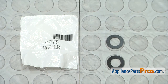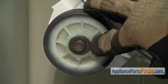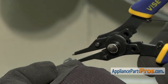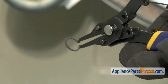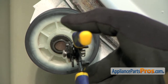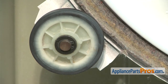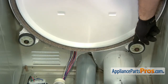Here's the old fiber washer next to the new one. You can get it at AppliancePartsPros.com. We already put the other washer on the back and the wheel is back on. Then we can put the new fiber washer on the front. We're going to take our snap ring pliers and hook it up to the snap ring so we can put this back on. Remember, you just want to open it enough just to get it over the shaft. Once you have it in the groove, you can let go of it and make sure it's locked in there. You can pick up the drum with the belt and guide it through the little cutouts in the cabinet and set it on the rollers.